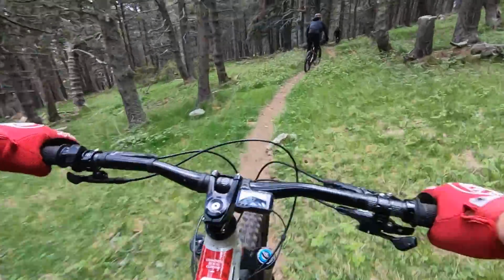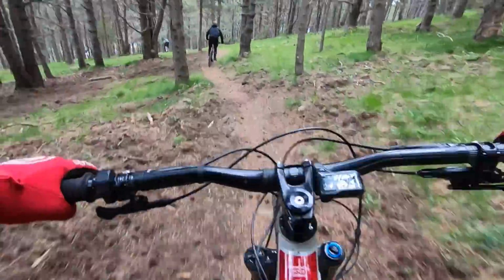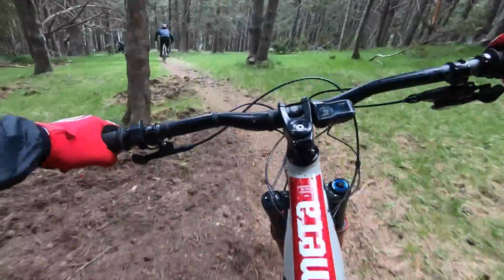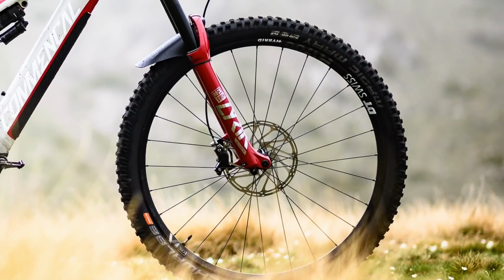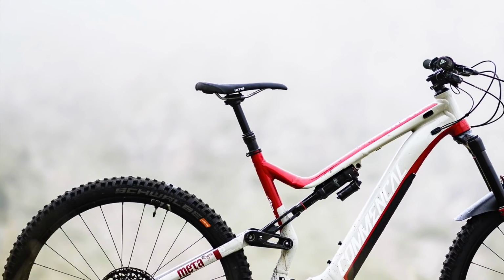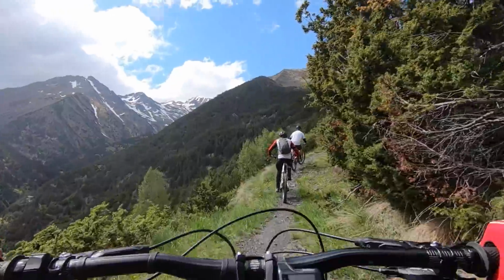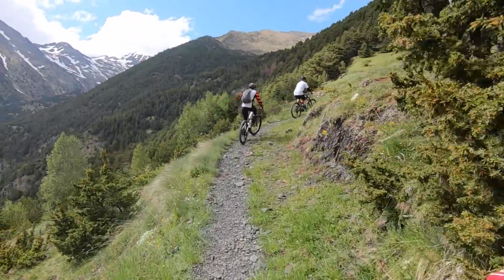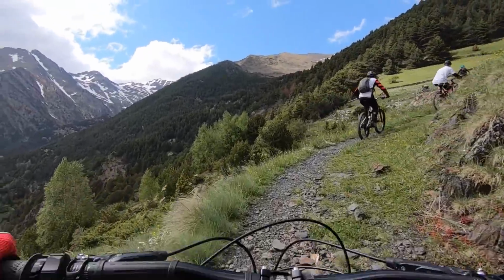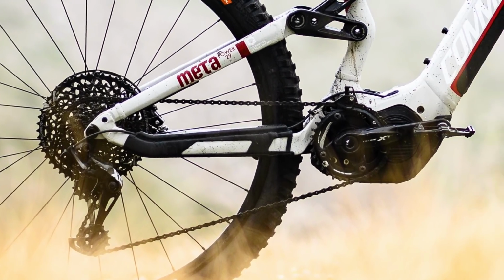Power 29 is a bike where you can really climb steep, technical trails, and then go down and find a lot of flow where there is no flow. So to us, it was really important to find the right balance between climbing and downhill. The head angle got a little bit slacker. We have 64.5 degrees, and a 77 degrees seat tube angle, so it's quite steep and really helps to keep a good position on the bike. At the same time, chainstay length is slightly shorter than before.